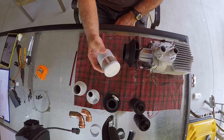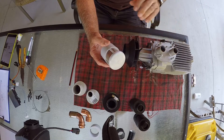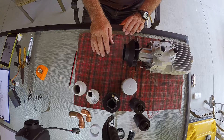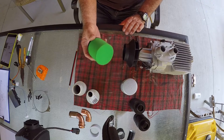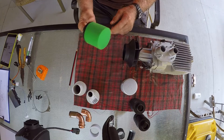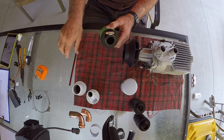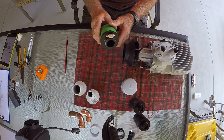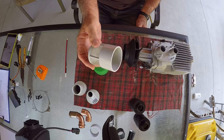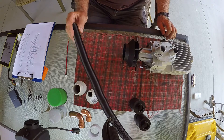You really have to have some sort of filter on the air intake into the combustion chamber - you don't want bugs, bees, or ants coming in. If you're in a dirty area with a lot of dust, or using the heater while traveling on dirt roads, you need a good intake filter like this one. This is a motorbike foam air intake filter you can buy at a motorbike store. You can get different diameters to fit different hose sizes. Whether you use this type or the mesh type depends on your operating environment.